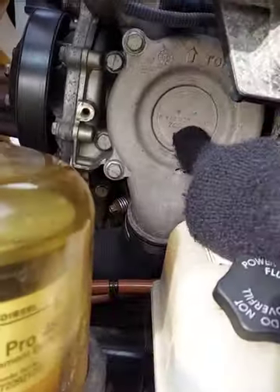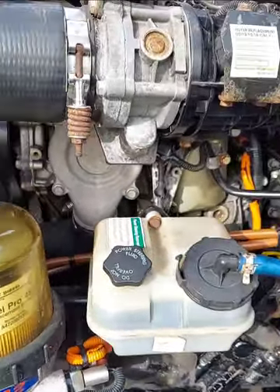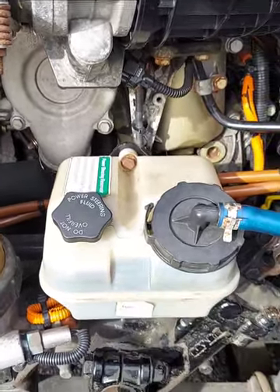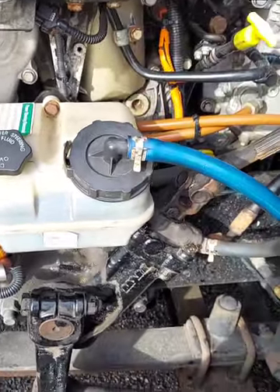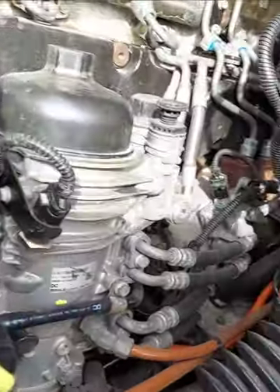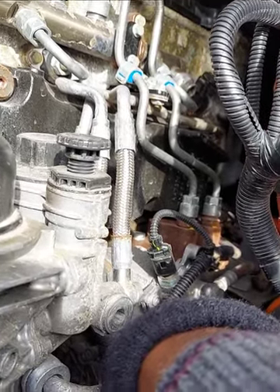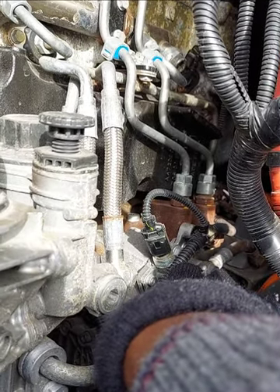With my water pump, no crack, dent or leaking, got water inside. My power steering, no crack, dent or leaking, and proper level as you can see. Hoses and steering box are also secure, no dent or leaking. My compressor governor is inside here, secure, not broken, no broken line. And my compressor is gear driven.